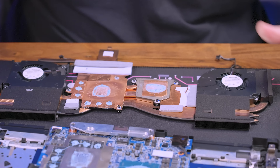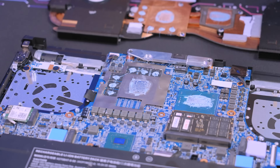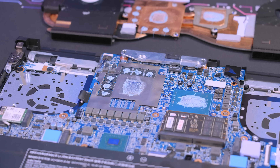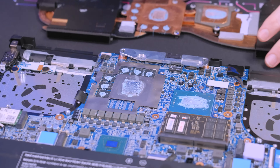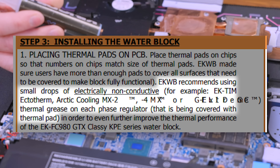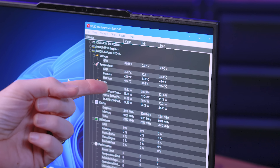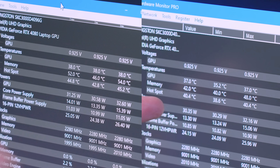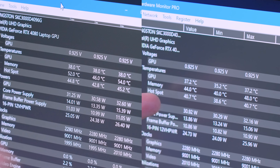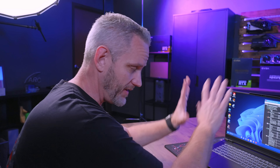I'm glad I did this. Let me clean this all up, put the thermal pad on there, and then a drop of thermal paste on the thermal pads. This might look weird to some of you, but this is actually how EK water blocks used to show it in their manual. Now with the new application — this is already 10C cooler for RAM. You can see it jumping between 42 and 48 at idle. It was in the 50s — 52, 54 — before. So we're 8 to 10C colder already just booting up the system.